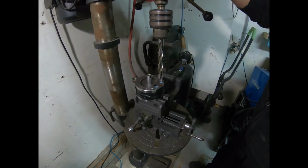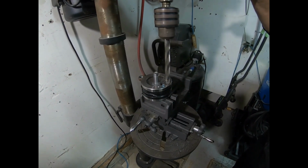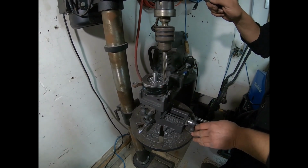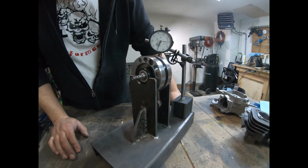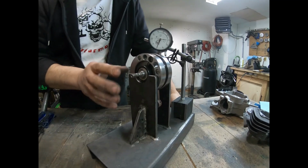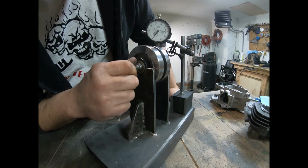Okay, now I'm going to drill out one of the larger holes now using my pilot bit. Okay, I've finished drilling all the holes to balance the crank to my piston for the rotational mass. Now what we're going to do is I'm going to true it. So we're going to try to get this so that it doesn't have a run out of 4 thousandths.